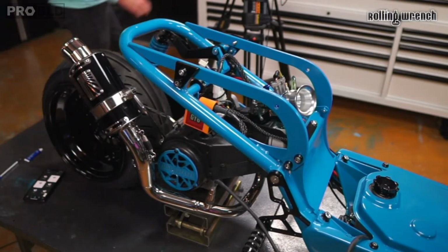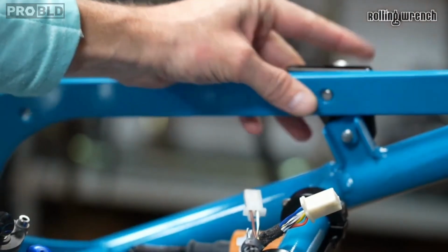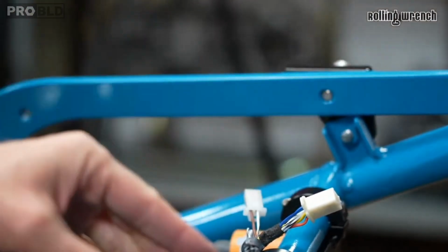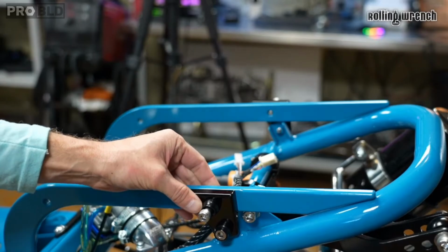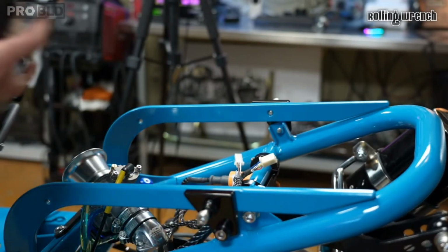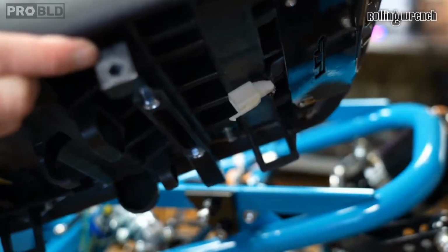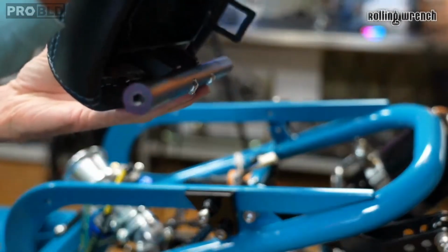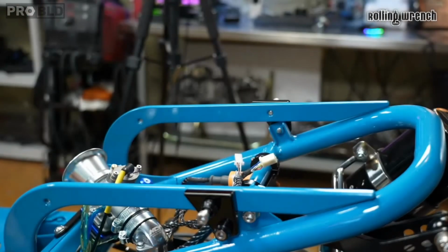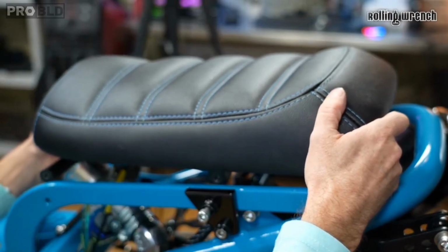All right, now the seat. See these screws there? Make sure they're not sticking out. Just push them in so they're flush. Because then you can't slide your seat on. Because this guy is going to screw right into this part of the seat frame. See that hole there? Then your front ones have that hole. That's going to be up here, down right here, actually. So we're just going to try to line these up real nice and easy.